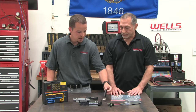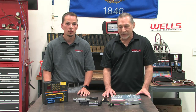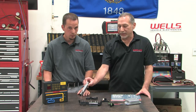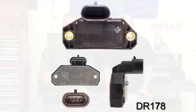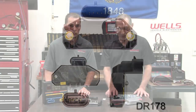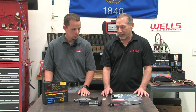Will this be used on exterior mounted ignition modules as well? It was originally just for distributor mounted modules, but there are exceptions. Ford has a TFI module on their Bronco and Ranger trucks that is remotely mounted, and GM also used a distributor-type module remotely mounted on their pickup trucks and on the LT1 type engines, which is mounted on the ignition coil bracket. These type modules also require heat sink compound applied to the bottom side.